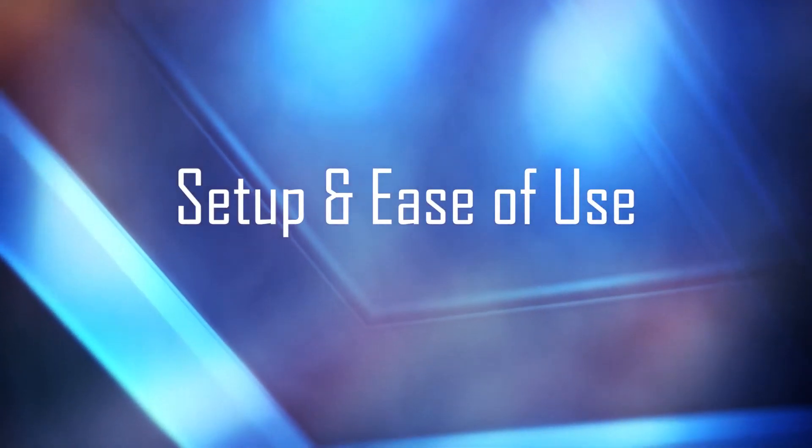The process of connecting is super easy. You just plug in the power, get your Thunderbolt 3 cable, plug it into the computer and it should show up immediately. One thing I had to learn is it essentially sees it as a separate display-type device, so you have to disconnect it before you unplug it. Think of it like mounting a USB drive — you should always disconnect before you unplug the cable.